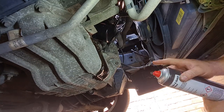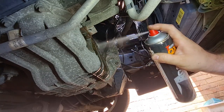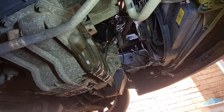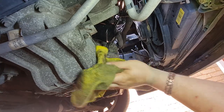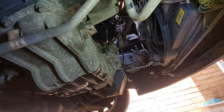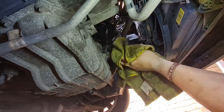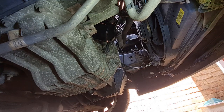Now that's all on there and clean, we can give this a little spray down with brake cleaner, just to get rid of all the old oil that's drained down the side of the sump there. Just makes it look a little bit nicer - if anyone looks under the car they can see it's been done as best as it can be. That stuff dries very, very fast - it's obviously got a solvent in it. Nice and clean and dry - like we was never there, apart from the fact there's a brand new oil filter in there. That is the two jobs under the car for the service done. Now we need to go topside, do the air filter and spark plugs, and then we can do the pollen filter and fuel filter.